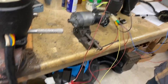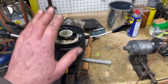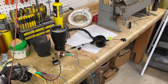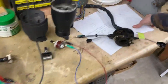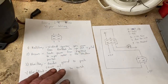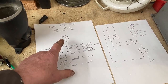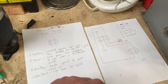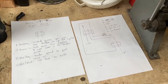We had to do a little modification of the wiring in order to return this to variable speed, because it had a two-speed switch in it before that, by the way, wasn't wired correctly anyway. We have a complete description that we're providing our customer with, describing the differences and how it will be wired in the same four-pin configuration for the wiper extension. This describes exactly how the variable speed works, so he'll be able to plug this into his car with no problem.